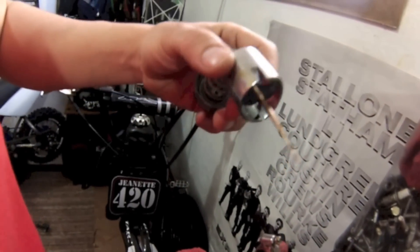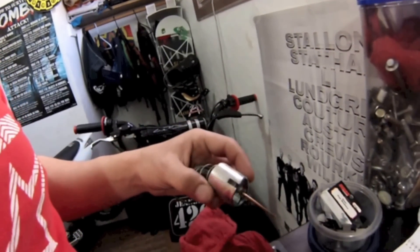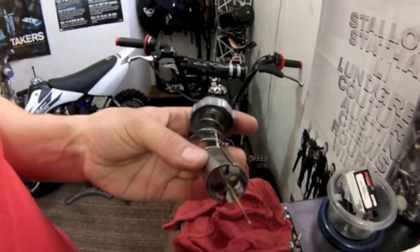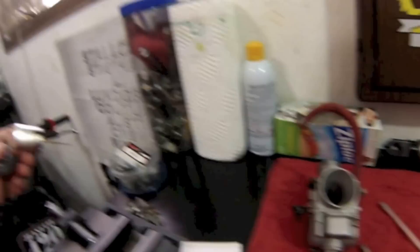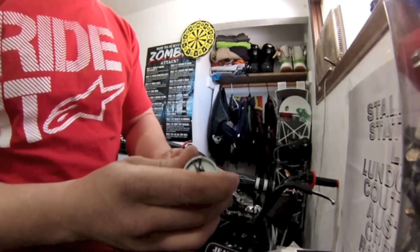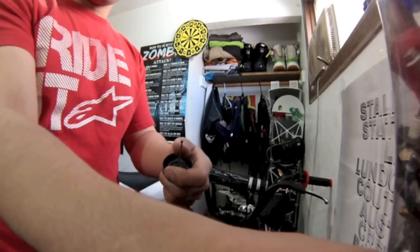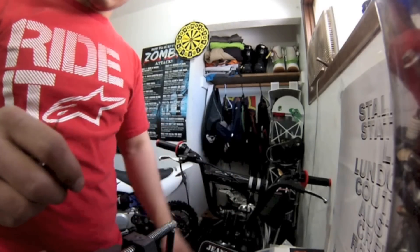That will show you one part of your adjustment: the needle. After you take the slide out, you're going to inspect the needle. The needle is responsible for a quarter to three quarters of the throttle setting. With the slide pulled out and the carburetor aside, you want to take your needle apart from the throttle cable. How you do that is you're going to push the needle out through the bottom — make it come out like that. Then set the spring aside; make sure you don't lose it. It's pretty hard to find once they go bouncing everywhere. Set this aside and you can just let the cable fall.